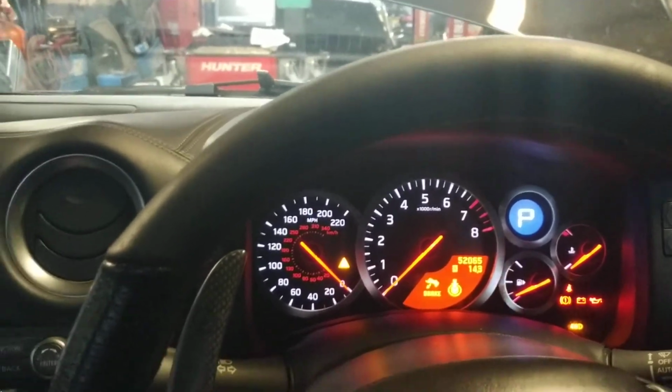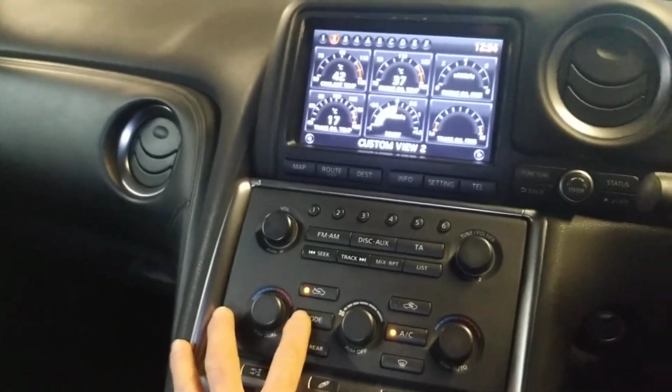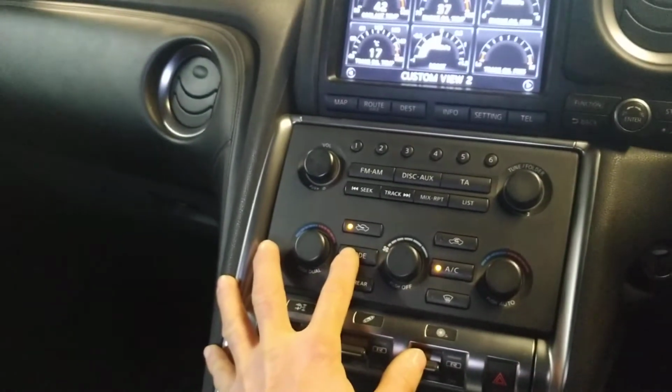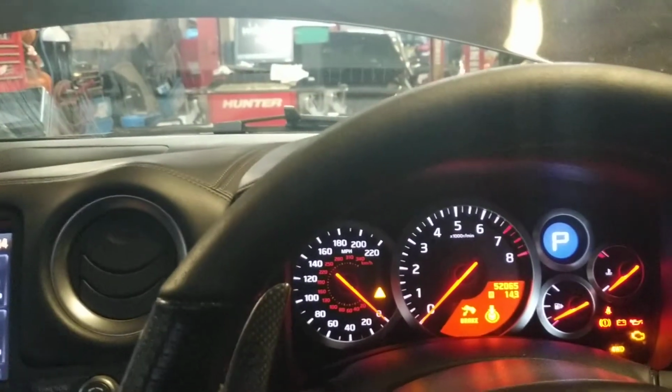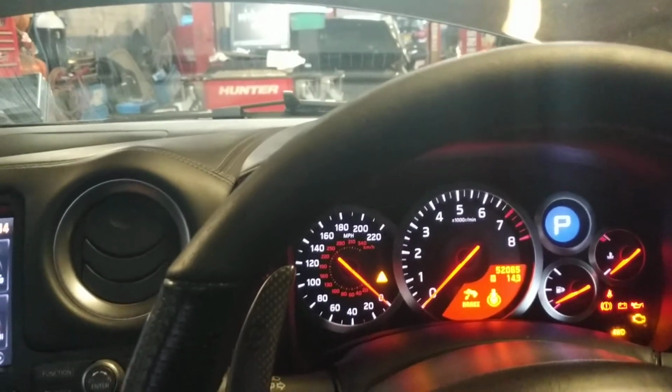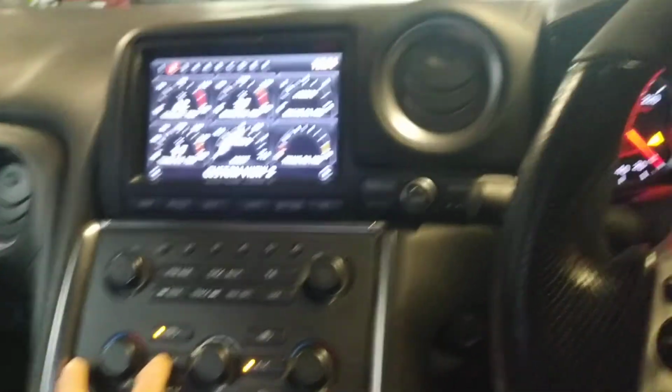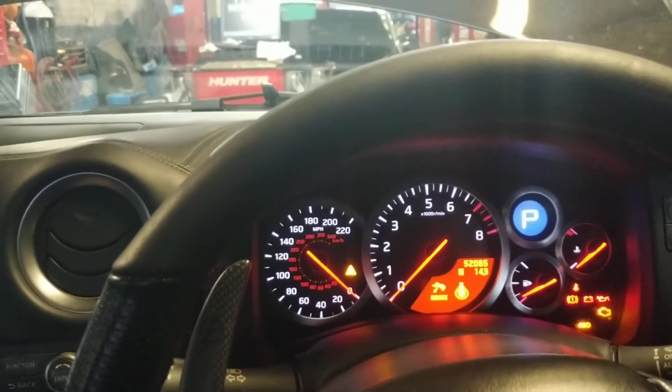So here we're going to select something very, very straightforward. We're going to use the mode button. So you see the indicators are flashing away. So now every time we push this button, if it's on the network, the indicators will flash to say, yep, we can use this button. You can push the buttons anything between 4 to 21 times. Once you've selected your push sequence, it will pause, give you a 3 flash handshake, and then ask for the same code again. So we're going to do that now.